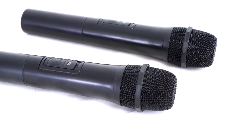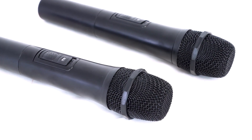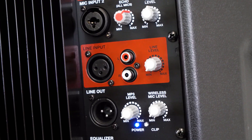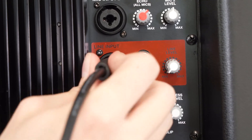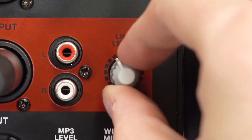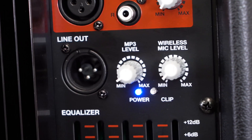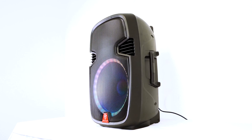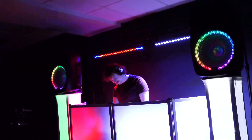If you press the wireless mic priority button, music will lower every time you talk through the wireless microphones, which is great if you are making announcements at a house party or a show. Under that we have our line channel which you can input through RCA inputs or XLR, and it also has its own volume knob. Right under that we have our XLR line output which allows you to send signals to another powered speaker or mixer for a bigger professional setup.